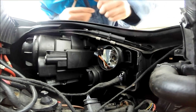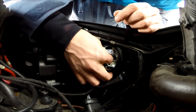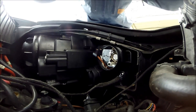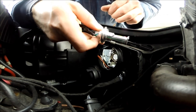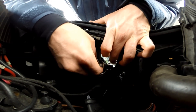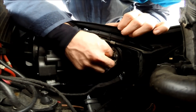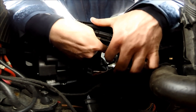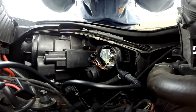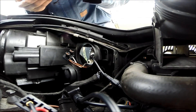I'll get underway with removing the stuck halogen bulb. The installation of the LED bulb was pretty easy, but the wiring for the bulb was tricky. On a regular halogen bulb, the car's connector connects directly to the bulb, but in this case it connects to the ballast and then runs through wires to the bulb. So you have to route the bulb wiring between the locking mechanism of the car.